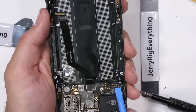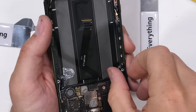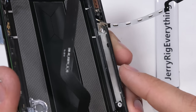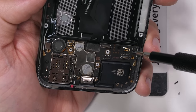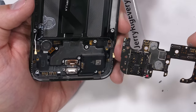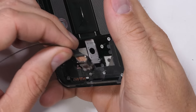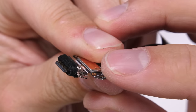Each side of the metal Black Shark 2 has its own LED battery level indicator light as it's charging. But even with the large cutouts in the metal frame for the LEDs, the phone is not structurally compromised. The LEDs themselves are on a thin little strip of ribbon that shines the light into a super thick cloudy plastic diffuser. Since the LEDs are pointing inwards, it's probably why the light seems a little dim at times, but it's still a very interesting concept. The bottom circuit board has two screws along with some wire cables, and then the circuit board can be removed, exposing the ultra large loudspeaker housing. The charging port comes out next — it's right next to the headphone jack that doesn't exist. I still think it's pretty crazy that a gaming phone can be built without a headphone jack.